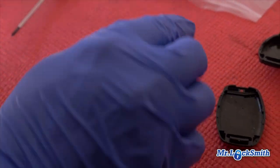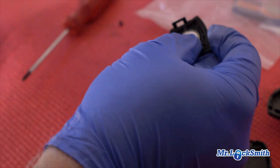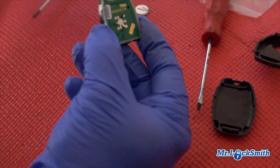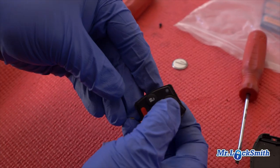There's the old battery. It looks harder than it is — you just gotta be careful and take your time. We're gonna replace the battery. It's a CR1616 — a three-volt lithium. It's a CR1616. And there we go, it's working perfectly now.